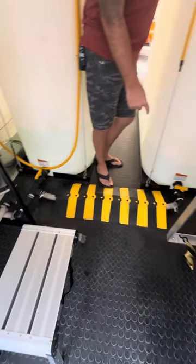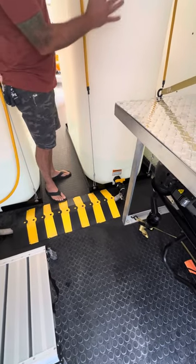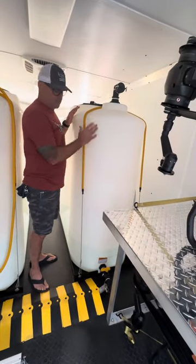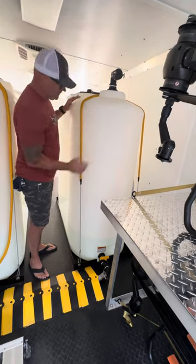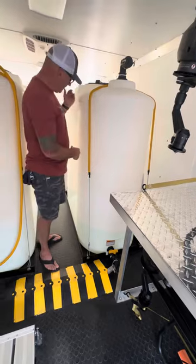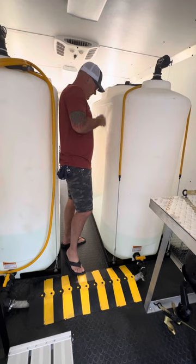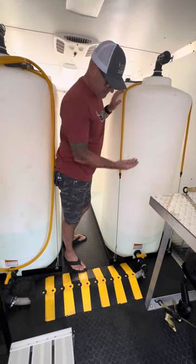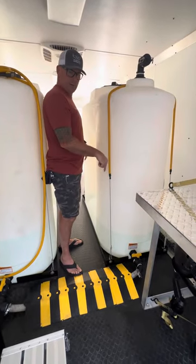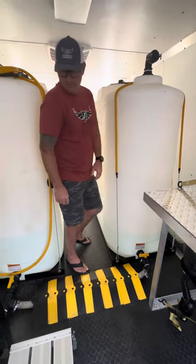It was Ben's idea up at Pesco to create these angled steel trays that hold these tanks. He said he's seen rigs get completely blown out not having their water secured. We've got cables running up and over, holding these on both sides front and back. These are called doorway tanks — they are baffled, with a void section in the middle that minimizes sloshing in transit, especially when they're half full. They're bolted through the aluminum joists but also spanned with a plate underneath to create more strength and integrity.